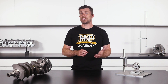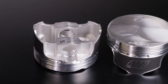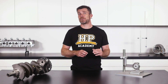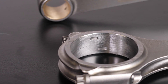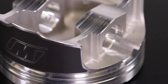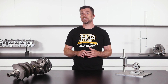On the other hand, if we're dealing with a V configuration engine such as a V6 or V8, the conrod and piston mass actually needs to be taken into account when the crankshaft is balanced. The engine machinist will perform a calculation to come up with what is referred to as a bob weight. That bob weight takes into account the weight of the connecting rod, the piston, the ring assembly, and also a calculation to allow for oil that will end up clinging to the piston. Once this bob weight is calculated, a physical mass is attached to the crankshaft while it's spun up and balanced.